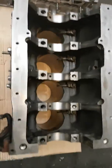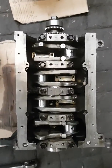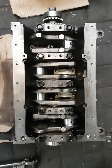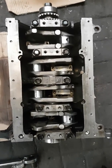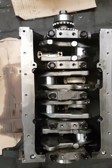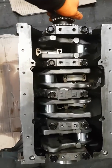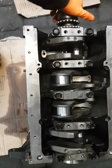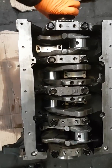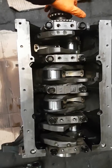So we'll go to the engine we're working on. We've just installed the pistons and crankshaft to this block, and the conrods are not connected yet. The reason for that is we want to make sure the crankshaft spins freely after it's properly torqued down. This has been properly, fully torqued, so if we just grab the crank - it's just totally free with zero resistance. After it's fully torqued down, there should not be any resistance whatsoever. After it's torqued, then we're ready to connect the conrods.